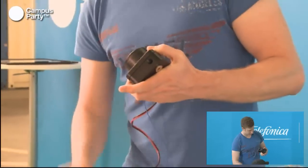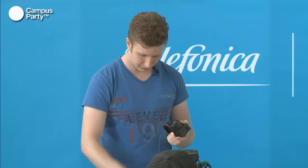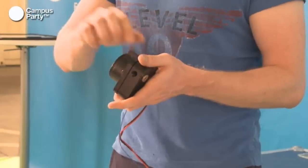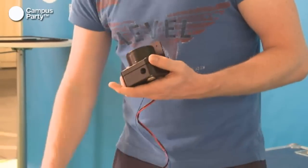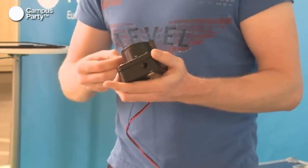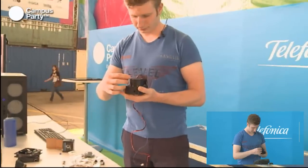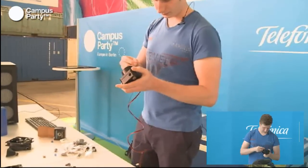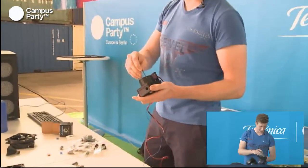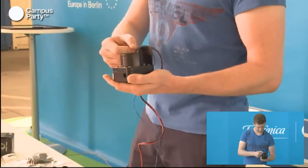And down. When you're pulling in the screws again, it's best to tighten them from corner to corner instead of going one way around, because if you do that you can skew the block or make it go in an awkward position or way. So basically, just remember to take one in the corner, and then the other corner, and then repeat that process until you got them all.